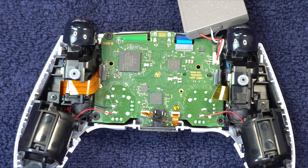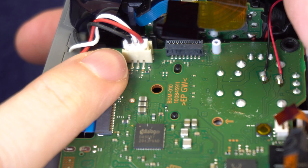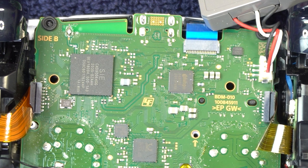This is a good time to take another photo. Next, you'll need to remove the ribbon cables that are connected to the board — there are four of them on my version. You may have a different revision of your board with different ribbon cables, perhaps in different spots, so make sure you're checking all the way around the board. On mine, I just pulled each one out with my fingers. If you want to, you can disconnect the battery — you'll just have to pull it out of the connector. But there is a risk: it might be so tight that you pull the whole connector off the board, in which case you're screwed. So I'm just going to leave the battery connected and I recommend you do the same. Next, we're going to take the board out — it's held down by two little black tabs. Push those outward, then push up on the analog sticks until the board comes out.